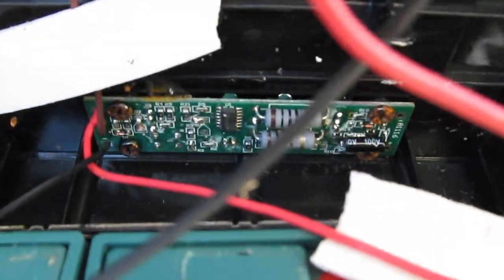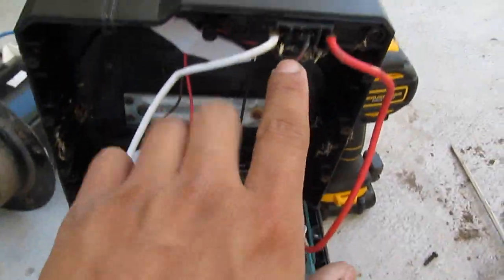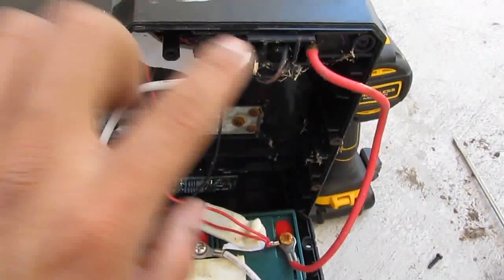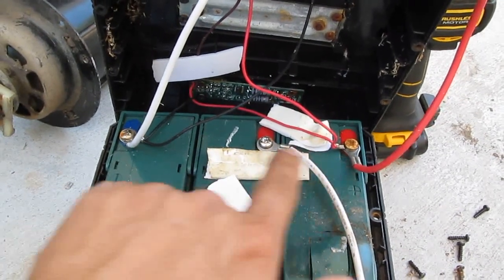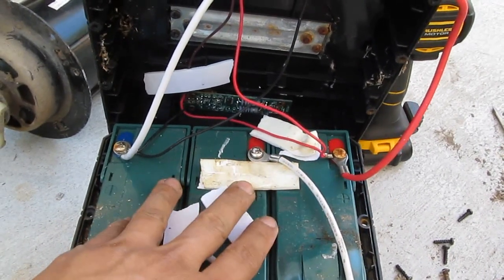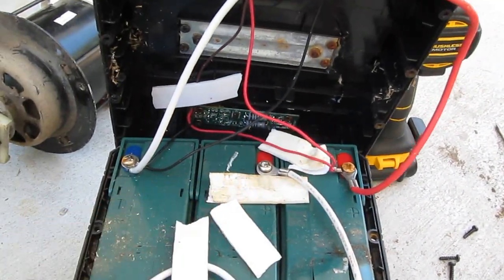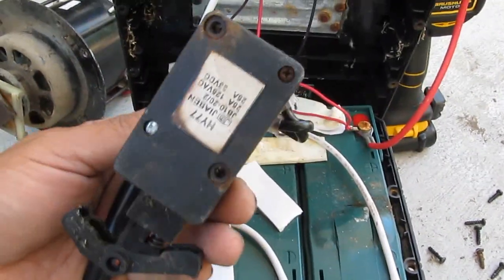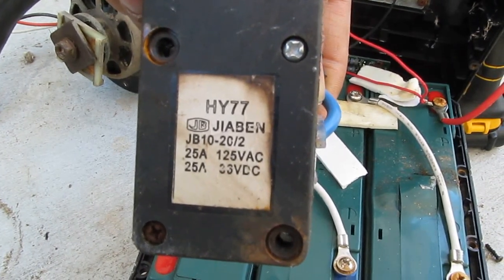It's too small to be a controller. The wire that comes from the motor goes in here on the top, down to the two terminals of the battery pack, and it does not go through anything else — no board or controller at all. The wire goes straight to the battery pack, and then there's only one single button switch: a 25-amp 36-volt DC switch.